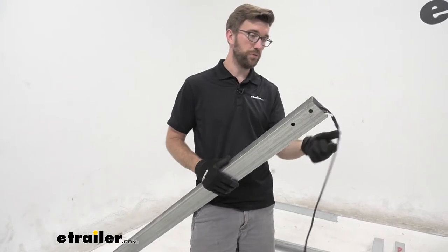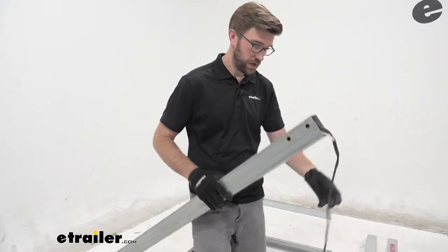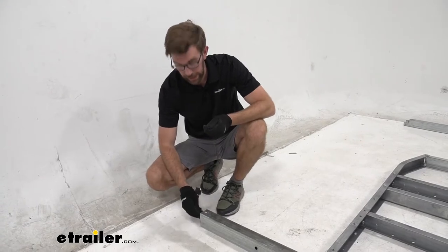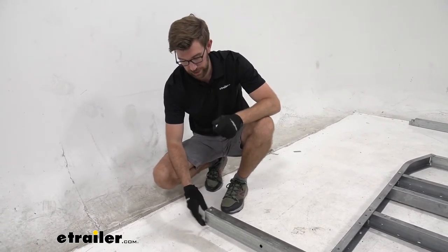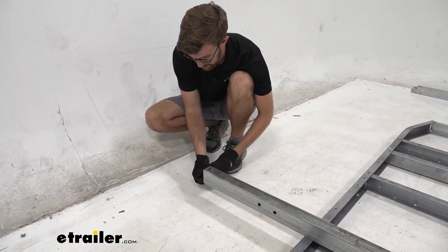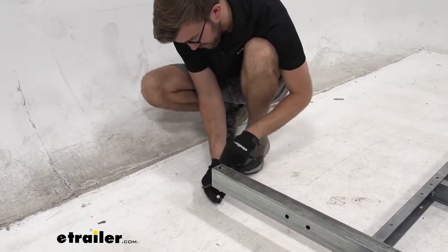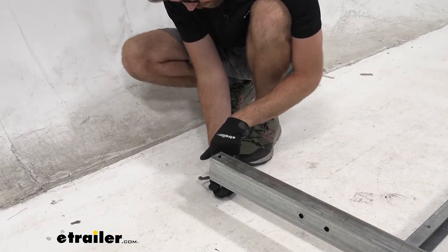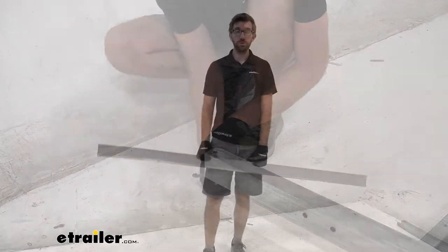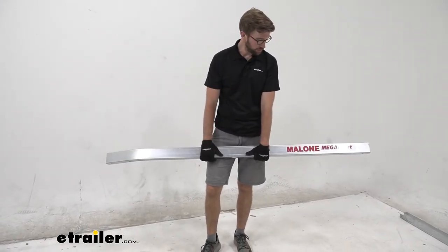We'll fish the rest through if we need more out of the back, but we want to be careful that we don't smash this during assembly. At the back end, we'll leave a little bit hanging out so it's easy to make the connection later. I'm going to take one of the bolts and nuts we used earlier — same size — and drop it in as a safety for now, get that loosely installed. Once that's done, we can lay the tongue down where it's going to go and start adding the rest of our pieces.